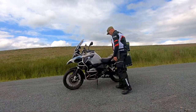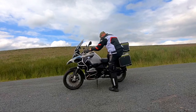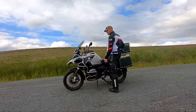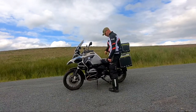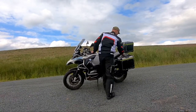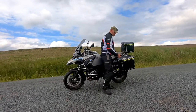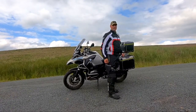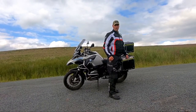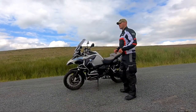So what you want to do is grab your handlebar, put your stand down with all your weight, step on that, try and push it down while right here you lift that up. You want to do that action — the bike will move backwards because you need to move it that way to get it onto a safety stand.